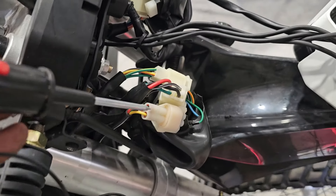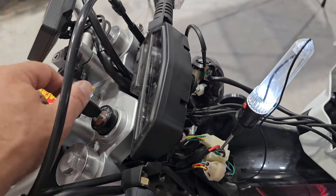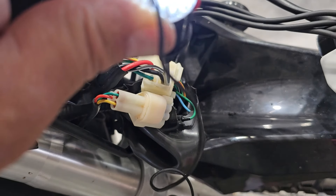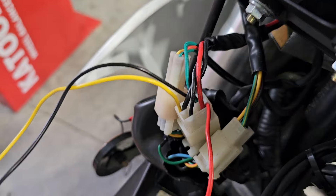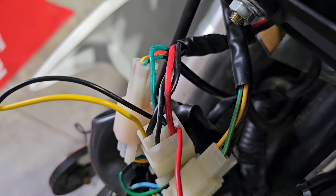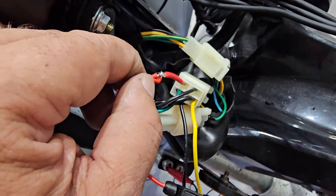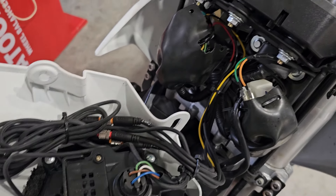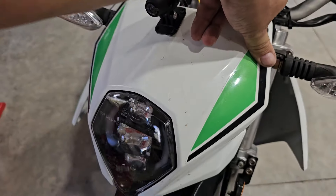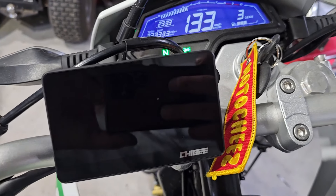In the power line — now let's test which wire has power with the key off. It's typically the red wire. Yep, that one's power with it off. So now I'll turn it on — use the black wire, yep, so that's it, and green is ground. I prefer soldering my connectors over the squeeze connectors supplied in the kit. All soldered up, tucked away, tie-wrapped up. Hope there's enough room behind this light — oh yeah, plenty of room.